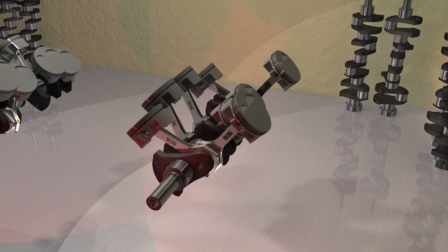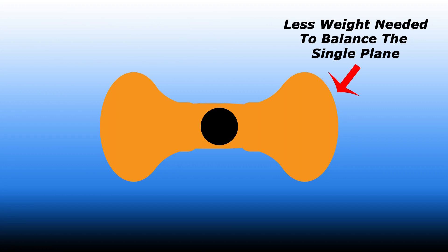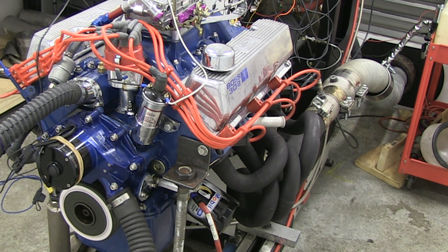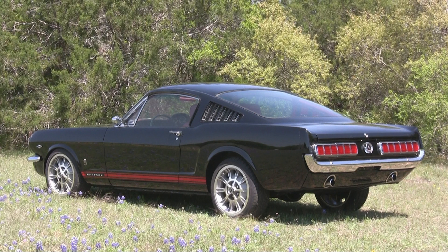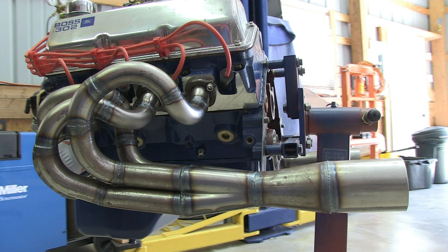The advantages of a flat crankshaft are: number one, the crank is light due to less mass in the counterweight areas — less weight means a faster response and higher peak RPM; number two, this crankshaft has an even or balanced firing order, which may promote exhaust scavenging. So why would one need a flat-plane crankshaft in a '68 Mustang? A 9,000 RPM capable small block is an impressive number.